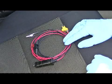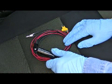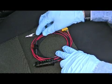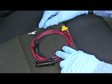I'm going to use a basic repowering rig to supply power directly to the airbag control module. The cigarette lighter plug will get plugged into an accessory outlet in the vehicle. The positive wire is red, has an in-line 7.5 amp fuse, and has a spade connector at the end.